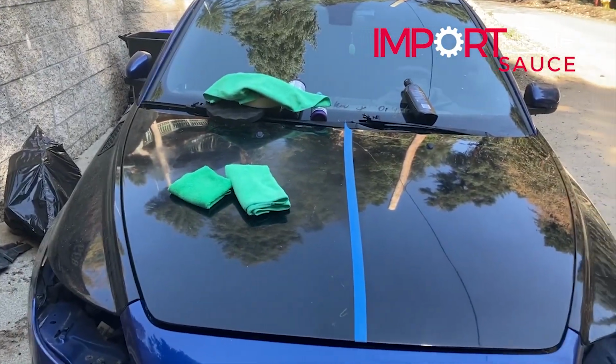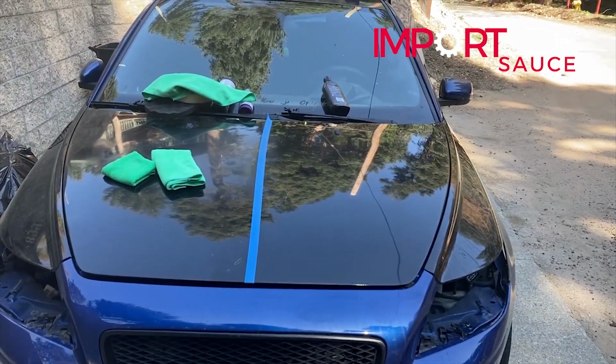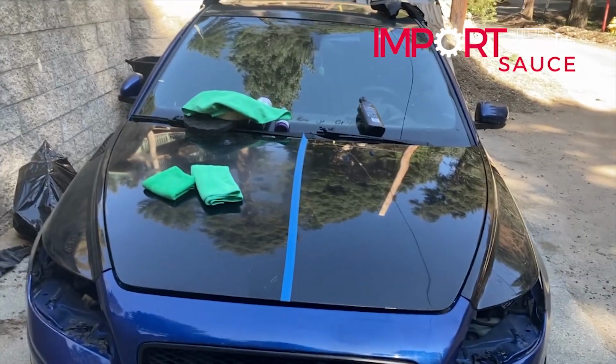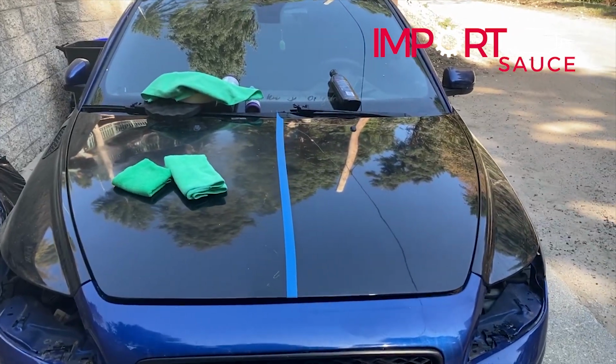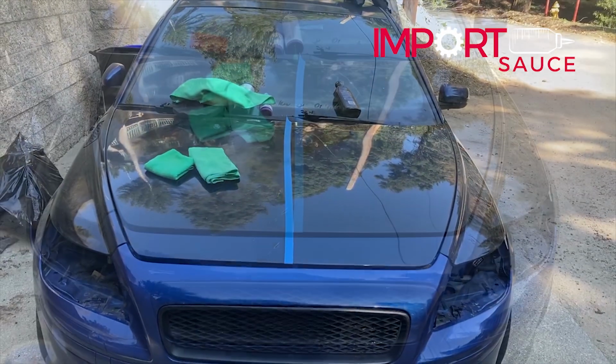At this point, the two rags that we've used are going to be not trash, but they're moved over to the dirty pile. We don't want to mix old compound, dirty rags. Every stage gets at least two fresh rags, right? One to pull the product off and one to really give it a good shine so that we can see what's going on. So we'll move on to stage two.